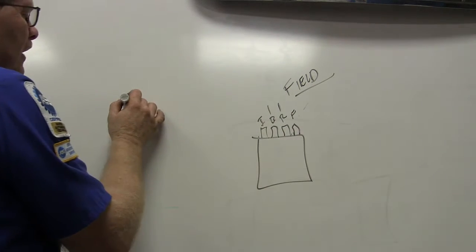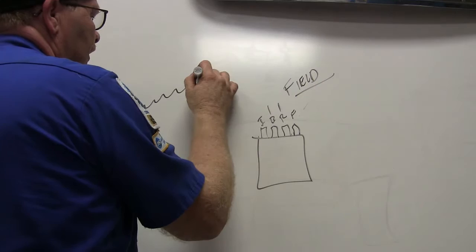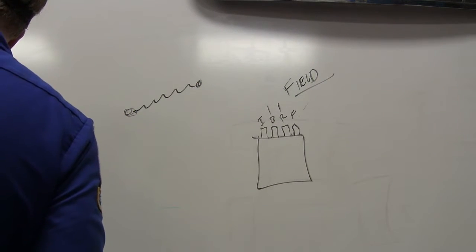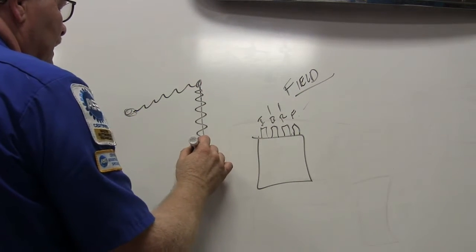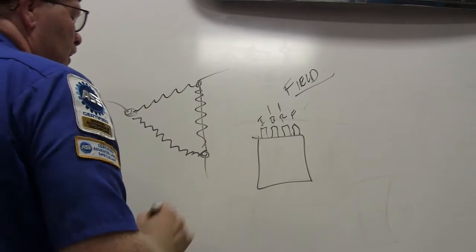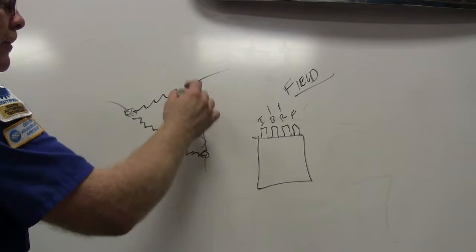R is actually, if you've got an alternator stator, and this is the part around the outside. See that part around the outside? It looks like a circle. It's over on the right. Okay, this right here, if you've got a winding like that, you notice it's got 3 junctions, right? This right here is a delta wound stator.